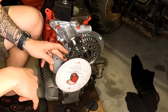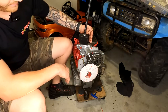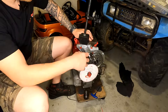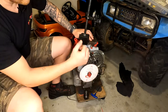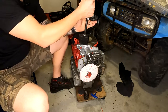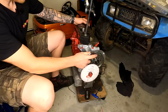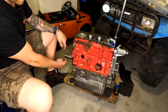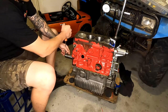I've got a UNC bolt with a bit of length and a little bit of wire at the end of it. We're going to be setting the crankshaft to top dead center on number one cylinder — that's this one here, where the dial gauge indicator is. This wire is what's going to enable us to set the top dead center mark and read it on the degree wheel as we rotate it around. We're not going to be turning the crankshaft from the front — we're going to be turning it from the back. All I like to do is just grab a long screwdriver, wedge it in the back of the flywheel and turn it side to side. Alternatively you can get the bolt, stick it in the end and turn it, but you do need to rock it back and forth.